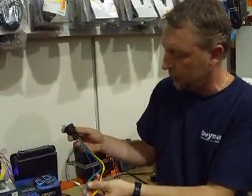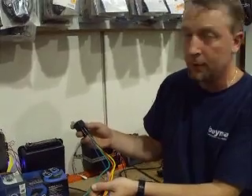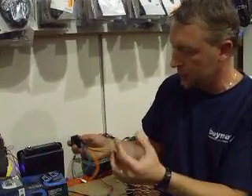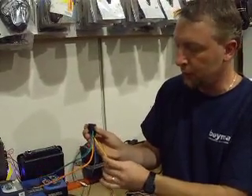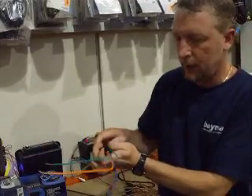I'm also using a nice handy 5-pin pre-wired relay socket with it. I've already cut off the middle pin, which is 87a. For this illustration we're not going to use it at all — I'm just going to kind of tuck it back for right now.